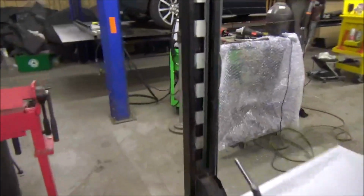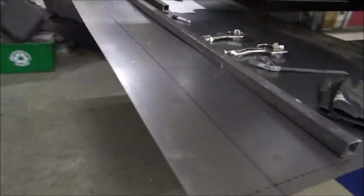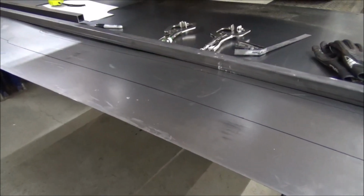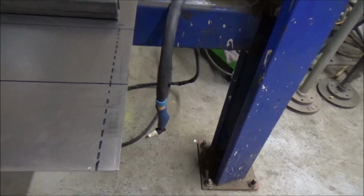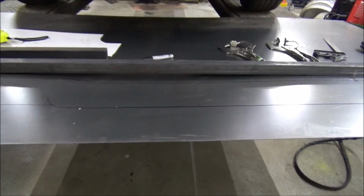Let me show you what I've got here. Yeah, I couldn't find any to buy that were priced anywhere decent, so I'm going to make my own. Here we go. And I've measured this out. These are supposed to be 75 inches long, so I measured 77. That way we have our inch here for a 90 to bend, and they come up, then all of a sudden they become 6.5 inches. Got to have that little curved piece in there, and of course bend on the end.